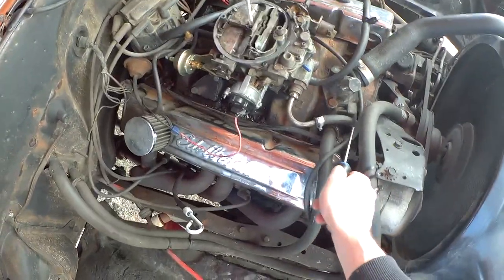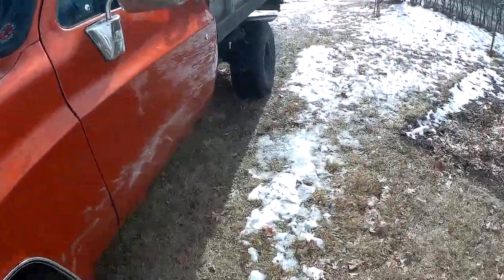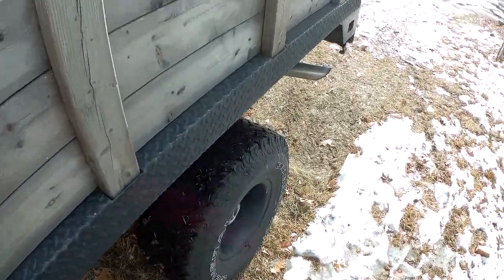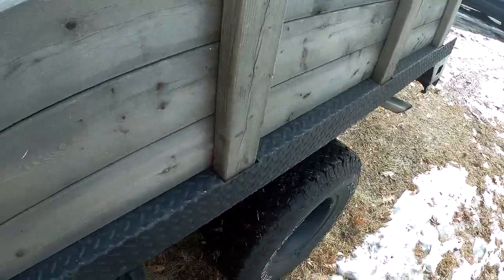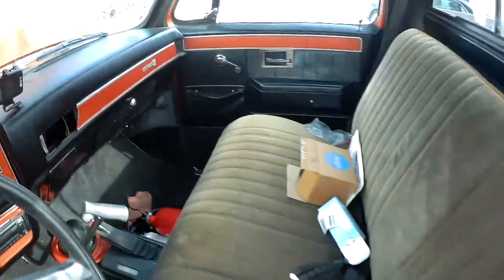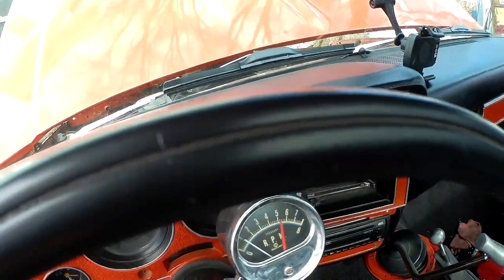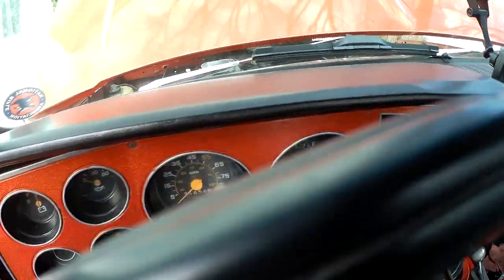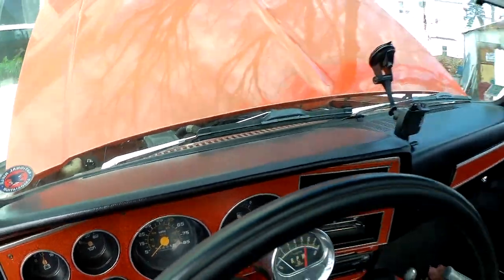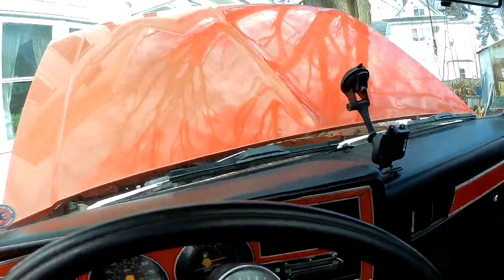Trouble in paradise — cracking fuel delivery issue. It's hard for me to ascertain right now whether the engine was running rough because there was water in it or because I had the mixture screws set poorly. But at the very least, we replaced that vacuum brake, so that's one issue taken care of. In the next episode, we're going to find out why the fuck my turn signals activate when I press my brake pedal. Alright, well until next time — thanks for watching, have a nice day.